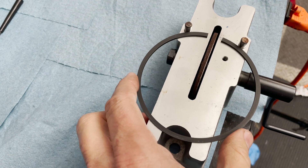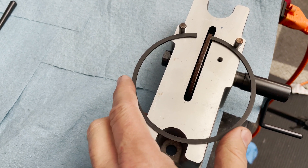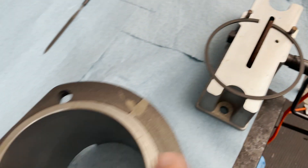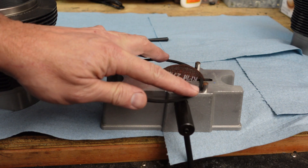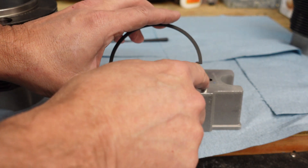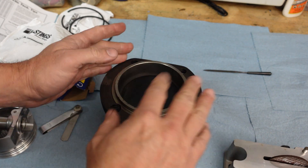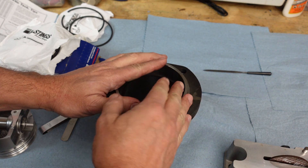The way the machine works is the ring goes up against these stops, and you can do one side or the other, but only one side. I'm going to put the ring against the support and the tool, then move the grinding wheel towards the supported side. I'll just keep doing that, sneaking up on the dimension until I get the proper ring gap. I'm holding it against the wheel, not loading it up too much, and I'm only going to move in one direction. You don't want this at an angle — you want the cut to be as flat as it was when it left the factory. I know I'm going to be doing a fair amount of back and forth until I get the right number, because you don't want to go too far. You can't put any material back — you really want to sneak up on it and not overshoot.